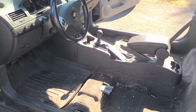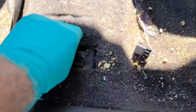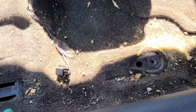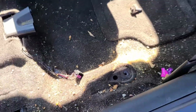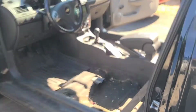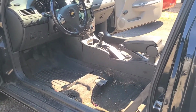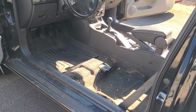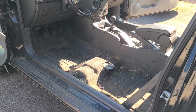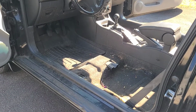Okay, when you're installing the front seats, you go down in these slots with the hooks mounted on the bottom of the seat first, and then you let it lean back and you line up the bolt holes, plug in the wiring, and do that on both sides. There is a possibility, if you're taking this out of a different year, that the passenger airbag sensor for the passenger seat won't match up, but you can switch those out and still keep the leather cover and the leather pad.